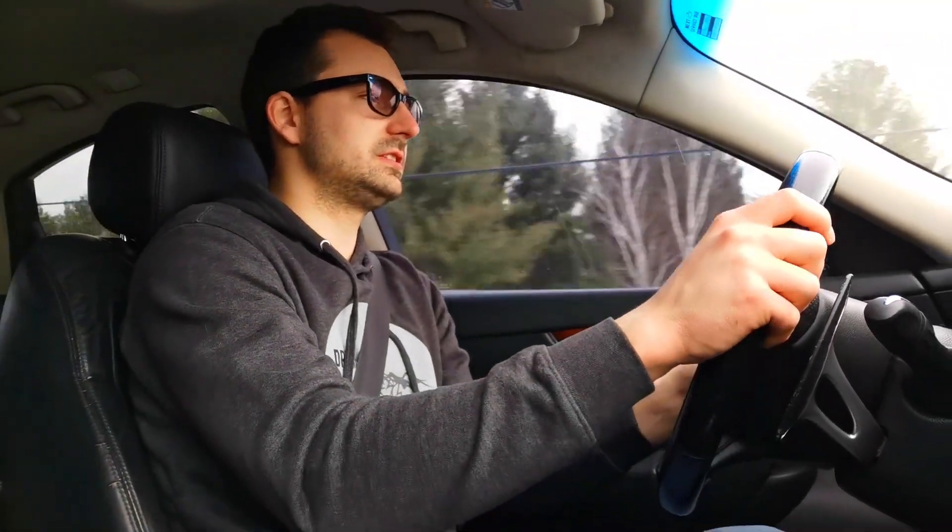You can just turn it on and off — so if you want a little bit more response, a little bit more weight to the steering wheel, you can just turn it off. It took a little bit to install everything and to find a proper place to mount the pump. A lot of people tend to mount the pump in the back, which seems more common for drift cars where space isn't as much of a restraint. But Tony wanted to keep this as his daily driver, so we didn't want to mount the pump in the trunk. Finding the mounting point was a little bit of a challenge, and removing the old rusted-out lines was a little bit tricky too.